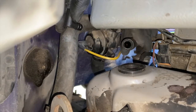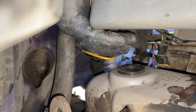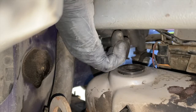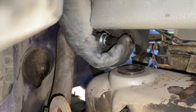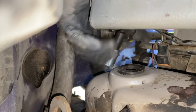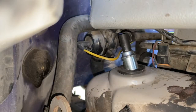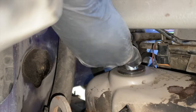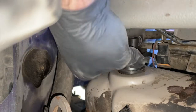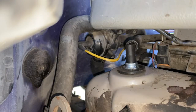Just like that, it's out. Using two hands, reach right back here and hold the tube, come in with your left hand with the PCV valve, and just insert it into the tube. Then you'll turn the valve face down, line it up, and push down — wiggle a little bit — just like that, we're in.